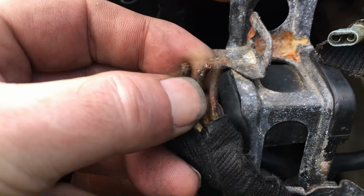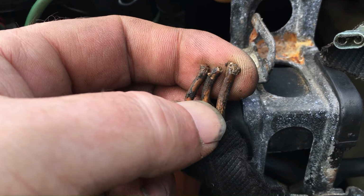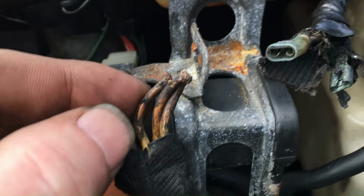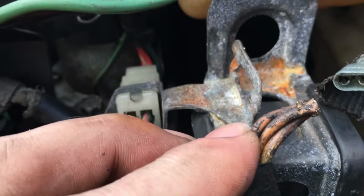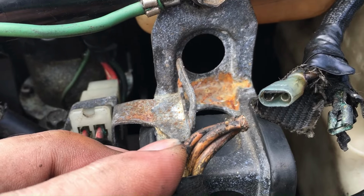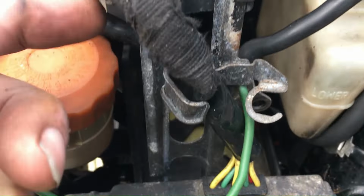As you can see, that wire is burnt, so we'll probably cut that back to maybe here, and then we've got to strip it, and then we've got to try and make it meet that. And yeah, there's about a 2-inch gap, so I need to see if I can reroute this wire and just try and find a little bit more free space from this.